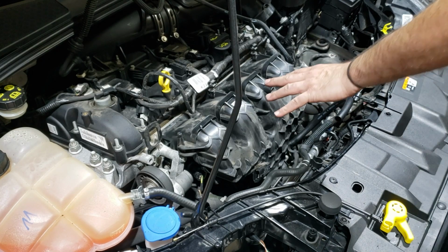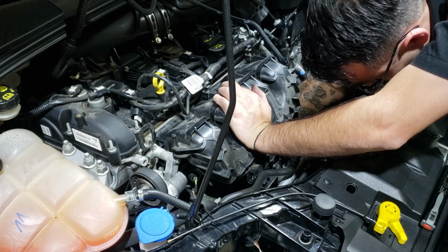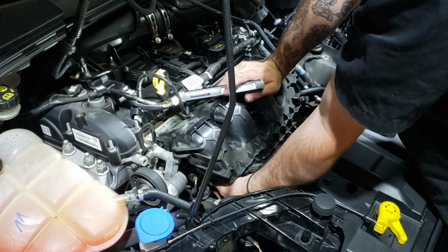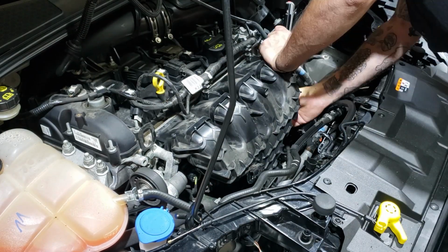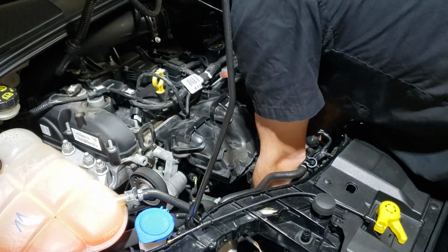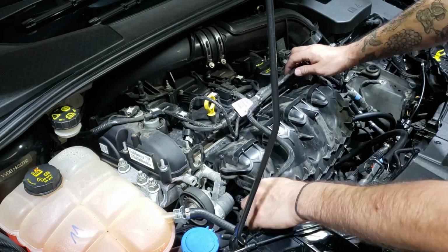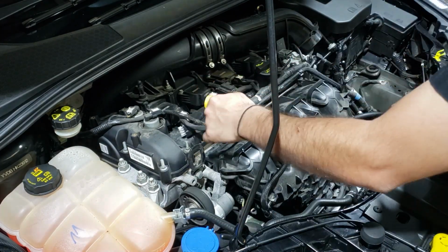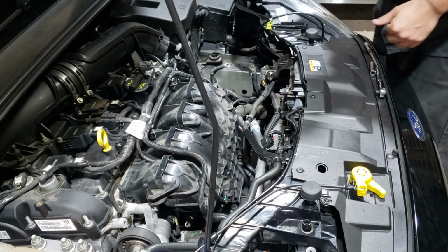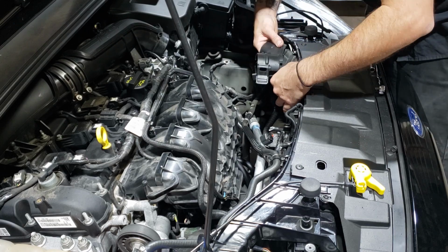Plug your throttle body and your other electrical connectors back in. And now lift up your boost pipe and tighten up that hose clamp. Refit this line. Plug the map sensor back in. Refit your airbox feed. It just clips in, there's a little clip there and there.